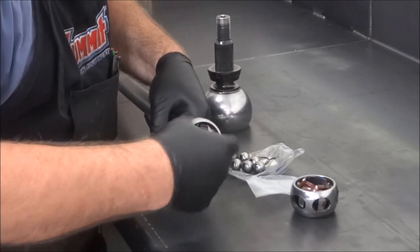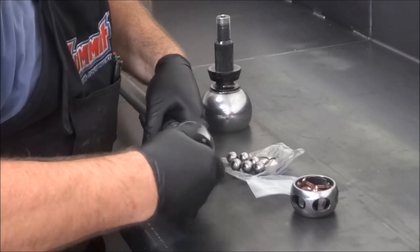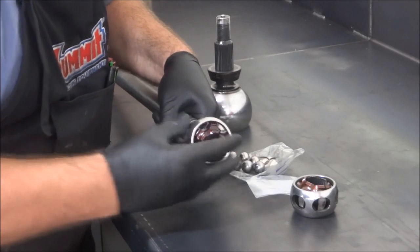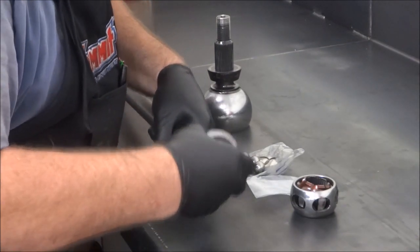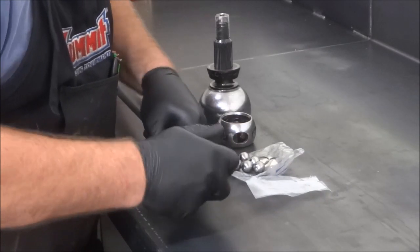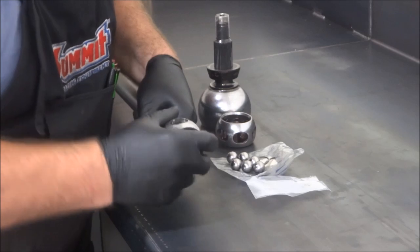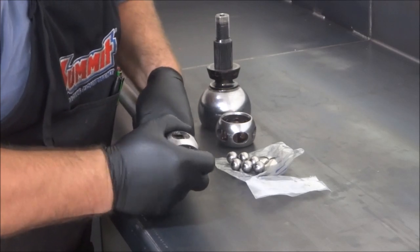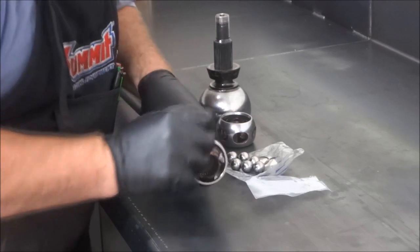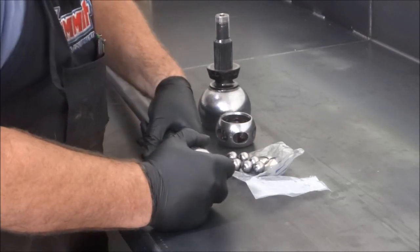That outer spherical cage spins all over, and at pretty much every angle, it spins freely. So that being said, I think the clickety-clack noises are this spherical outer cage going past the catches, and the ball kind of snapping past as that cage is going around. Because going straight, it was fine. It's just when I was turned.